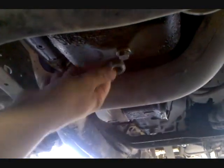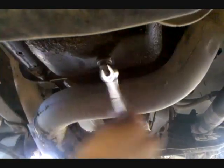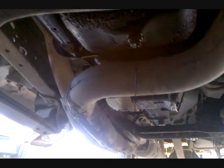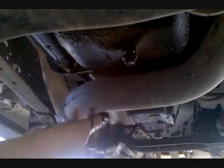Now the first thing that you do in an oil change, you wanna pop your drain plug loose. You can use a wrench or a ratchet, whichever you want. I better make sure that my little pan's in the right place — I've just got oil everywhere. Wonderful. Anyway, we are draining.